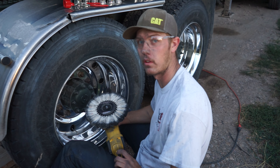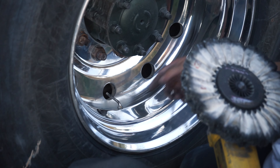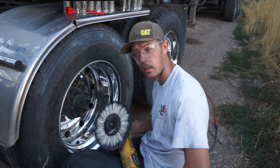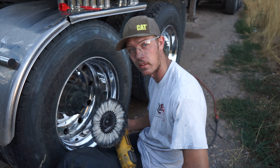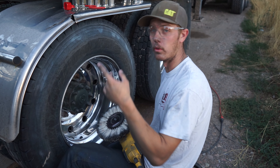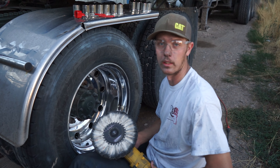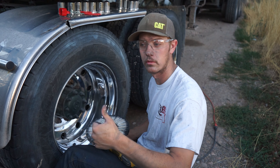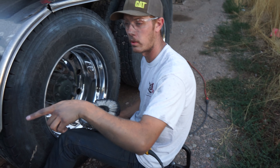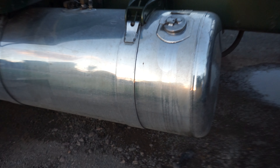So that was our cut. I'm gonna have to hand polish around the valve stem here because I cannot get in there with the buff. Now I'm going to turn down my RPMs a little bit and hit it again, but this time instead of putting so much pressure I'm just gonna kind of gloss over it, and then after that I'll do the Renegade hand polish and finishing compound. Also, see that fuel tank? Two or three days ago that was polished — so that's how this week's been going.